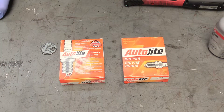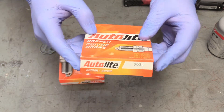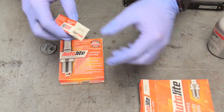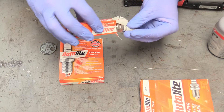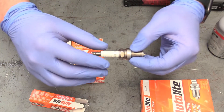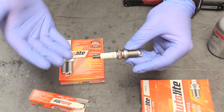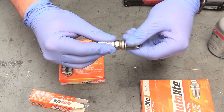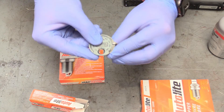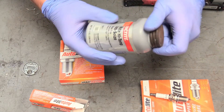Now we talk about our spark plugs — again sent over by Summit Racing, link down below in the description. According to our head manufacturer AFR, these are the plugs we should be using at our compression ratio — these Autolites. Our gap should be 35 thousandths. When you're looking at spark plugs, especially when received via shipping, with a gloved hand go over the porcelain and feel for any ridges or cracks. If you find any, return or exchange them — don't even bother installing them, it's not worth it. Then we can check our gap: 35 thousandths, right on the money. Awesome — it came out of the box at 35 thousandths.